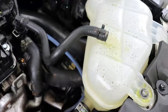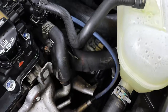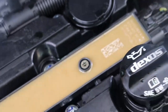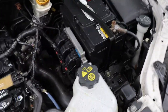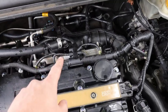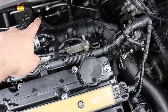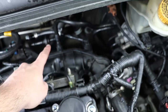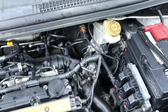Here is what happened today — this radiator hose right here blew up and shot antifreeze all over the engine, pretty much everywhere. I just finished replacing the battery, took the intake off, and installed a PCV bypass kit. It goes here, all the way back there, with a check valve at the back, and then ties into the vacuum lines — I believe that's the fuel evap canister evap line under vacuum there.